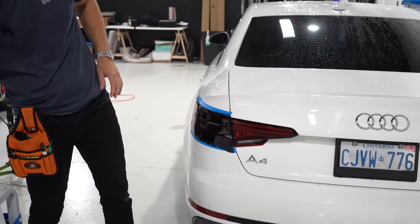Let's do the big one now — the large light on the left. Just trying to find that sweet spot. Let's just say we missed a teeny tiny bit of the light; it's usually not that big of a deal because you cannot tell that you've missed a tiny bit. This is why wrapping around the edge isn't so necessary. What wrapping around the edge can do is cause failure because we have too much film around the edge of the light that doesn't need it — there's nowhere for it to grab onto. I'm applying tension to the film and cutting at the same time: pulling with my left hand, cutting with my right.